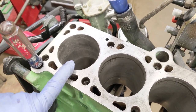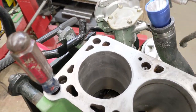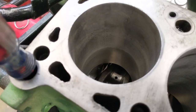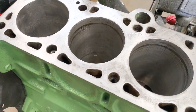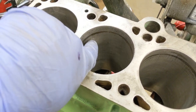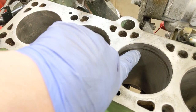This is my rusted cylinder. This one took the most work, and it is probably a little over what it should be for stock piston rings. There's just a teeny bit of pitting, but mainly just down at the very bottom where it was stuck, and maybe a little bit up halfway here. The top seems pretty clear where the compression is the most. This one, actually, there was quite a bit of up and down scoring. You couldn't feel them, but you can see right there. I tried to clean them up as good as possible.